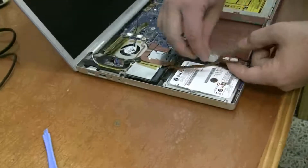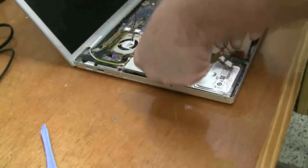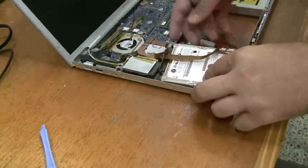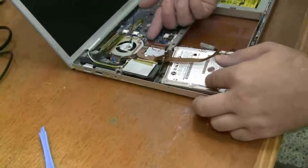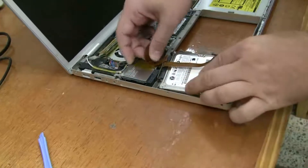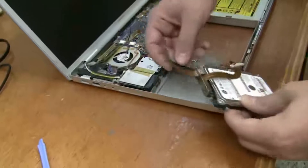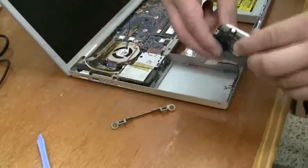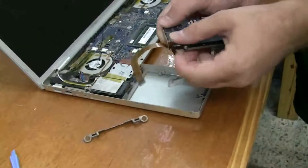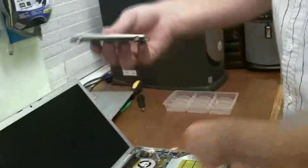Okay, we can take this Bluetooth out, and the hard drive should come up. Kind of got it coming out now. I'm going to pull it off the motherboard just right there, pull out this cable. Set that aside. Now just kind of work this out back and forth, and there you go — we've got the hard drive up.